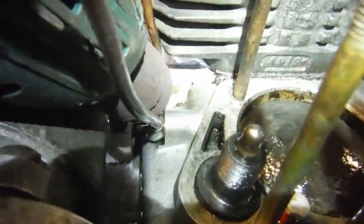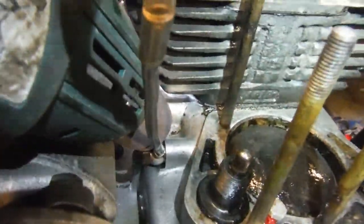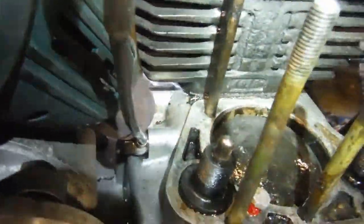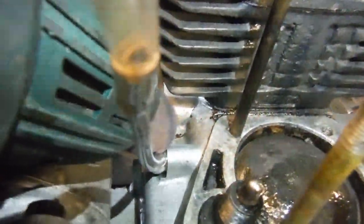All was going well for a while and I thought most of the oil leaks I'd been seeing had probably been an accumulation from higher up. But when I was pumping oil in with the heat gun going and that area of the crankcase was nice and hot, it's gone a little bit wet and oily looking there — right between where the cylinder barrels fit — and unfortunately that does look like a leak from the crankcase joint.